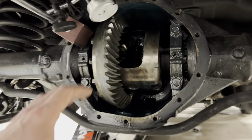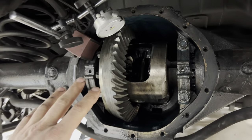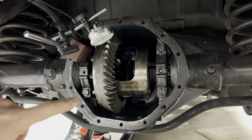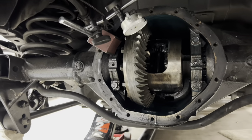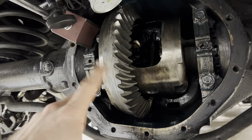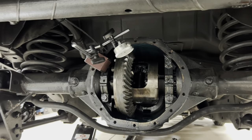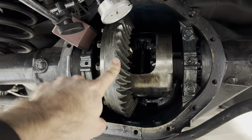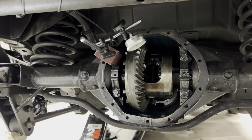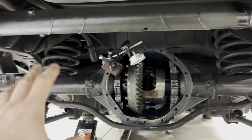We just pulled the 4.56 gear out that we literally just put in — we went from the factory 4.10 to the 4.56 because that was the ratio we needed to set the cam-only record. Well now we need to take that 4.56 back out because it's actually going to be too much gear trying to run into the nines — just too much mile-per-hour for the gear ratio. We've put the factory 4.10 back in, got the backlash set, dead on the number. Ideally we would have put a 3.90 gear in, but I don't even know if they make a 3.90 for a 14-bolt, and I'm just about broke trying to get this thing together for Sick Week.